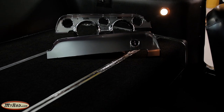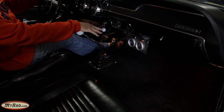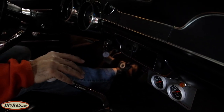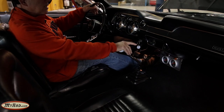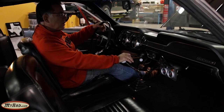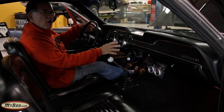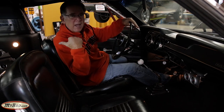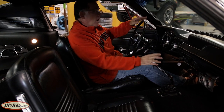When the brushed aluminum comes in here, the car will be much more impressive to look at on the inside. We're also going to put the '67 console in here, which means we're going to remove these aftermarket gauges currently mounted in the car. The radio is gone - we took out the original AM radio and sent it off. It's going to come back AM-FM with Bluetooth and an MP3 input so you can use it like a modern-day radio. Tyler will put some new speakers under the dash so it'll sound a lot better. We're also going to take all the interior out and put a sound-deadening package on the floor from front to back, to take a little of the tinny sound out and make the cabin experience more refined.